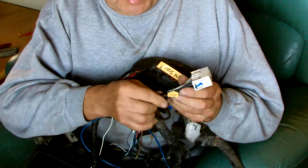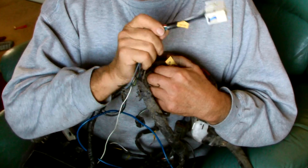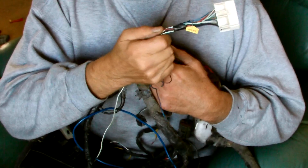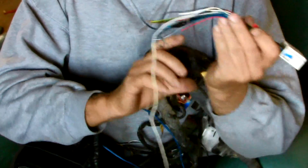For example, this plug I marked when it was on the car — near-side driver's door. That would contain the electric windows, the electric mirrors, and the courtesy light in the door. I know I don't need any of those on a buggy, so I was able to cut that plug off, trace all those wires back, and pull them out of the loom.